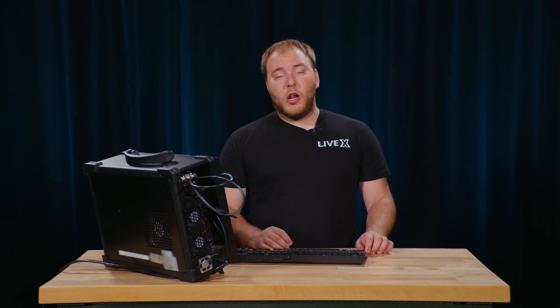So we're doing it with vMix. If you're doing it with just a base ProductionBot — like a Switch Force or a Switch 8 — it's not going to work because it needs a very specific card. A lot of the Blackmagic cards, the Decklink 8K, the Decklink Quad, the Duos — those all work. There are other Blackmagic hardware as well that works externally from vMix, and Bluefish cards work with vMix as well.